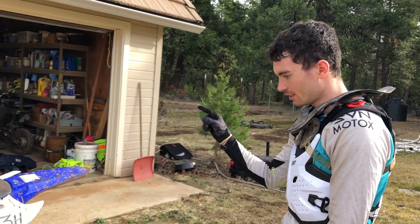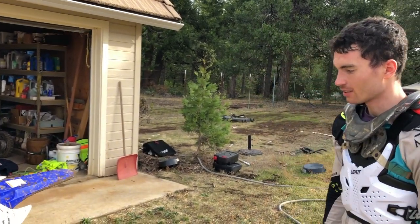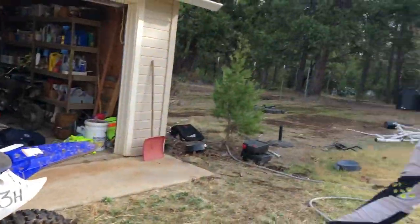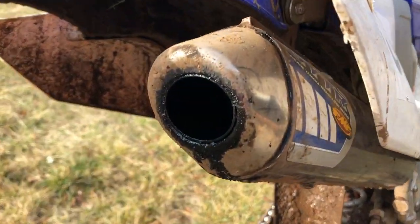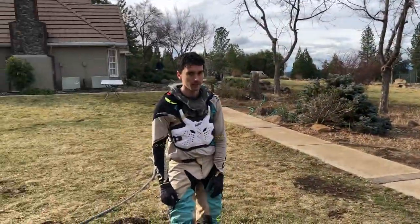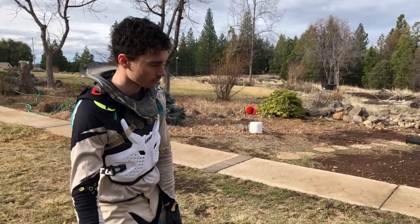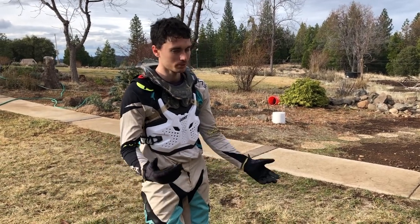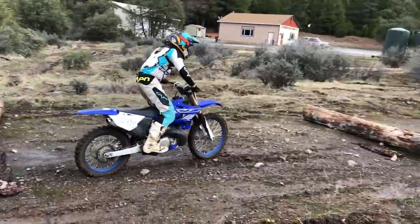So I'll break it down into a few categories. The motor is the first category. In my opinion, this motor is a little mellow — it's a two-stroke and it feels like a two-stroke. It doesn't have a lot of low-to-mid power. Stock motor, no pipe or anything, just a spark arrestor. We've got the GYTR oil drip edition like every YZ I've had. Even compared to my buddy Jack's bike — he's got a reed valve and a gnarly pipe — this bike feels noticeably slower. But the power band is very predictable; it doesn't stall super easily and can climb the slower hills.